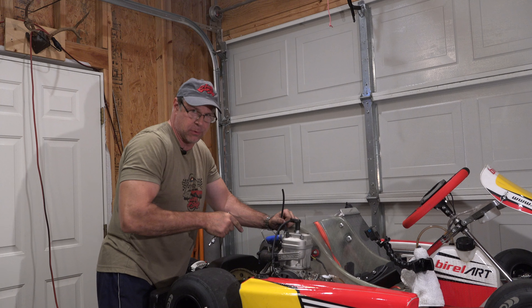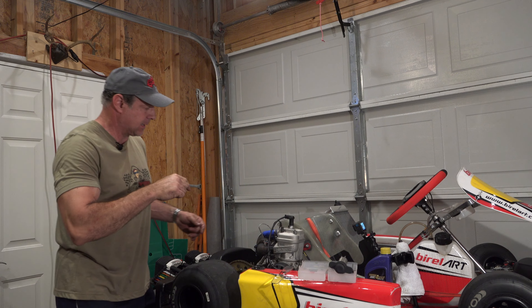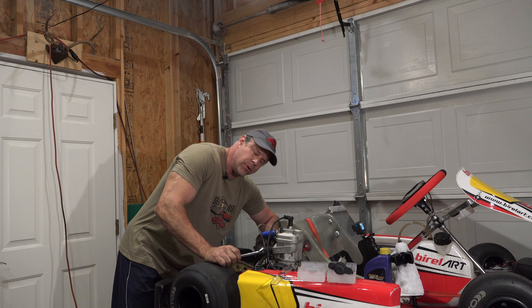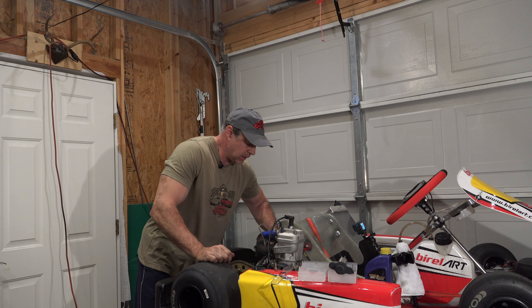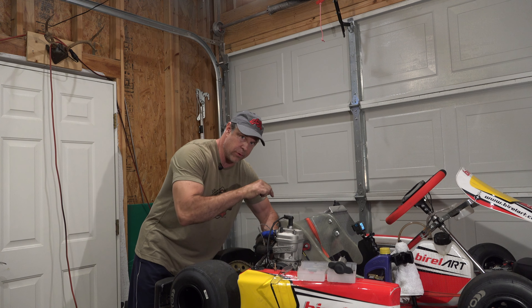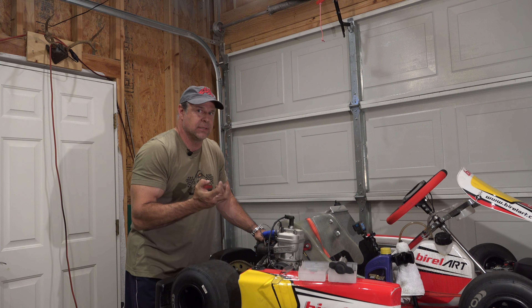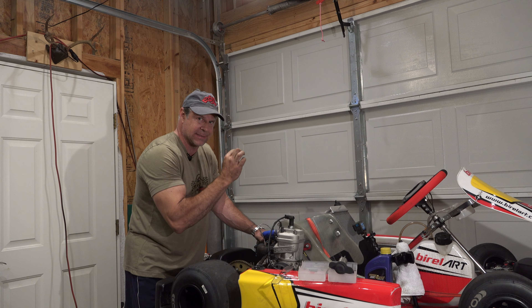We can move on to silliness number two: trying to fill this thing. I put the drain plug back in — no big deal. It's an 11 millimeter wrench to get the fill plug out at the top of the crankcase. You'd say, just get a little funnel, put 40cc's of oil in and let it drain down the tube — no, no, no, it's not going to be that simple. There is a bolt in the passageway between the top of the fill plug hole and the bottom of the crankcase, making that opening even smaller than it already is. My limited knowledge of physics says 40cc's of oil is not heavy enough to displace the air in the crankcase.